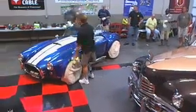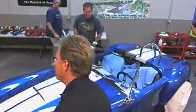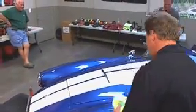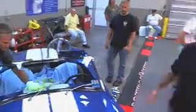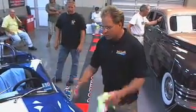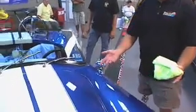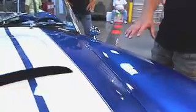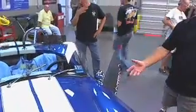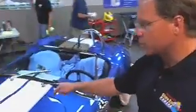Now remember when we brought this in here, we felt the paint. When I rubbed the paint the first time this car came here, remember it made a noise? It doesn't make any sound now. That feels good. It's smooth. The whole thing we did with these cars today, a lot of people don't really understand, is we made the clear coats clear. Because when you get thousands of swirls and scratches, it turns the clear coat opaque. It blocks your eyes from seeing the color underneath. Plus, it's not as glossy. What we did is we removed all the swirls and scratches, did 2 polishing steps. We used the Blackfire compound, the Blackfire polish, then we put the Blackfire carnauba wax on here. And you can see the blue metallic flake, what people call on the internet, it pops, because you can see the flake. The reason you can see the flake is because we turned the clear coat clear. That's why.